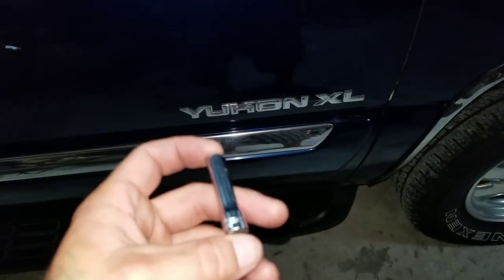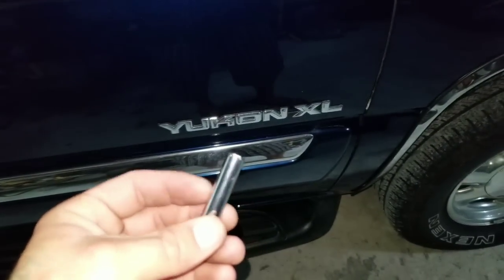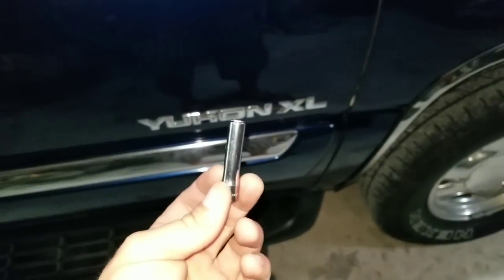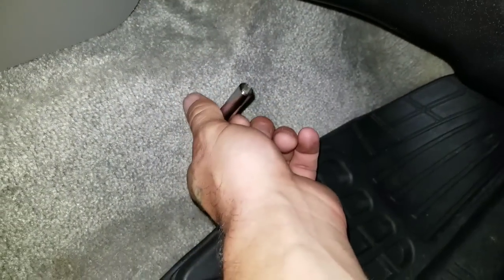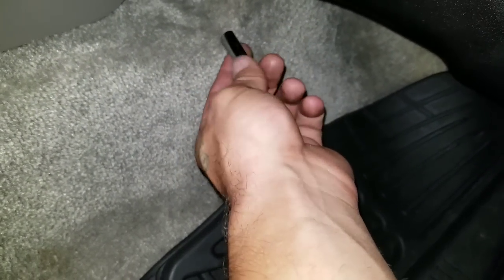Here's a quick tip: you might find that a 9/32s or seven millimeter long socket reaching back into that one pocket way back in there — just hand-threading it so far to get it tight instead of having the ratchet on it might work a little better, because it is pretty tight in that little area. So there's a little tip for you.